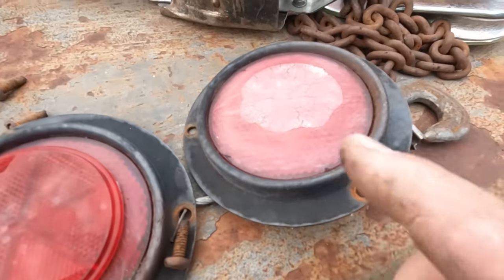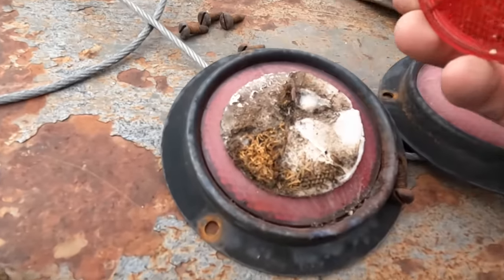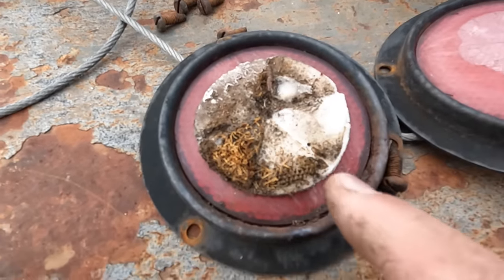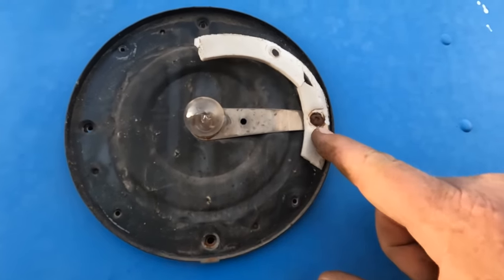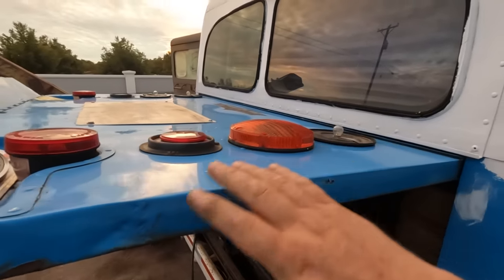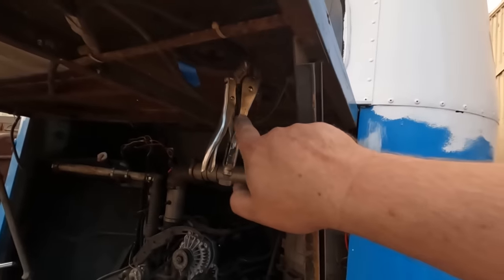Now that I'm uncovering some of these connections, I'm kind of glad I'm replacing the lights — I'm kind of surprised that's even still working. This was the ground wire for that turn signal, and I didn't loosen that screw yet — that's the way it was. It just had a wad of electrical tape wrapped around it. These old reflectors had new reflectors stuck to them — I peeled it off. There's moss. There's bugs. The one screw that has the ground strap is completely corroded away, on all of them. Luckily these lights are on the engine compartment lid, so I can get to the back side of them with vice grips.